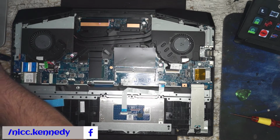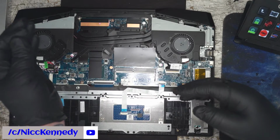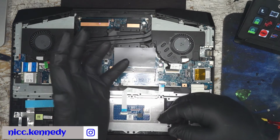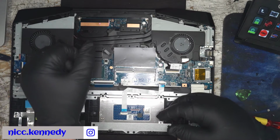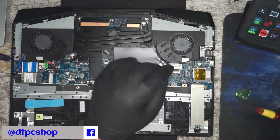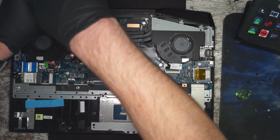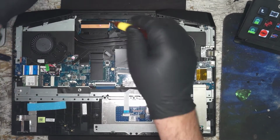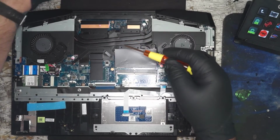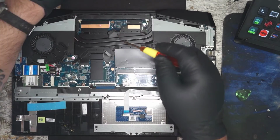Go ahead, we'll hit restart. We could boot to the USB or fire up a real Mac and clone the operating system over again from the 2 to the 3. The one major issue is we don't have any way to read that model of SSD other than to have it plugged into an M.2 slot on a motherboard. We have one motherboard here, the test bench with the tester SSD, but the tester SSD is installed elsewhere right now, testing hardware. So we really can't pull it and access our data there. Later, perhaps. Now, no. So let's see if we can continue down this road and get a model number.